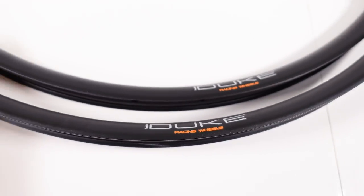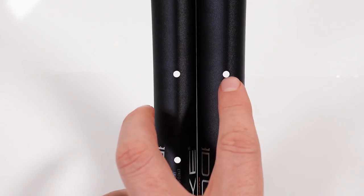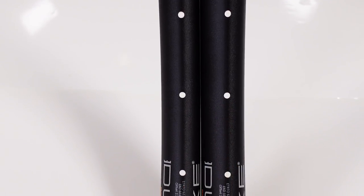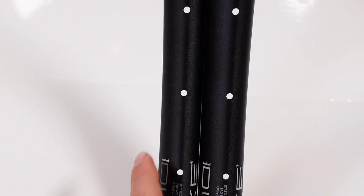What I have here is their Sisters concept, dedicated front and rear rims with special designs. If you look carefully you're going to see that the spoke hole is off-center. So these are offset aluminum rims, something pretty hard to find these days. I prefer offset rims because they allow me to build a better wheel.